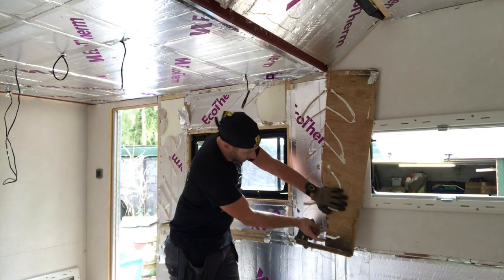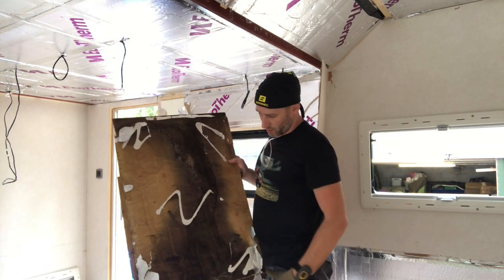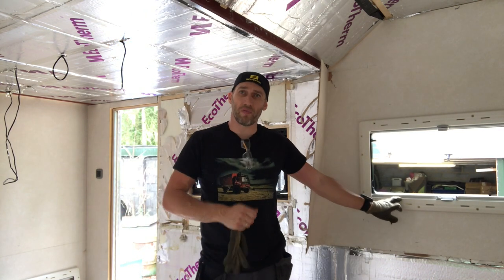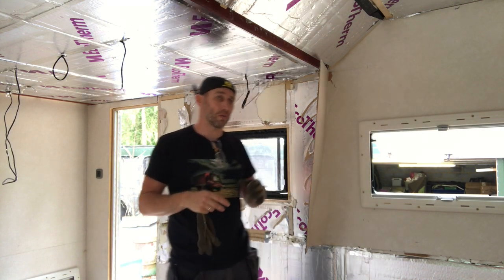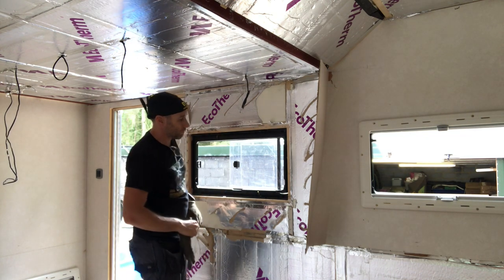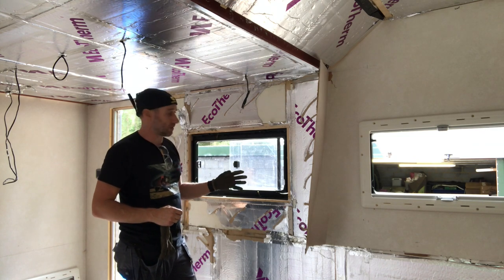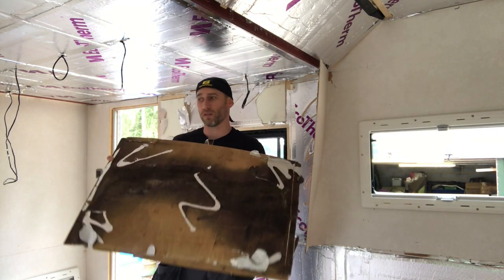Look at this - it's wet, or has been wet. Look at all that black marking where it's been wet. These windows weren't bonded in - they just had the inside fly screen part screwed together with a gasket around the outside to make a seal. I know it wasn't bonded in because I unscrewed the fly screen part, took it away, and the window fell out and smashed. You can see the cracks here - disappointing. It just demonstrates why you should bond your windows in with a decent adhesive and sealant.